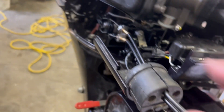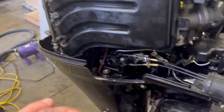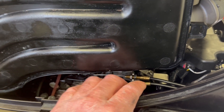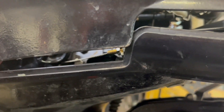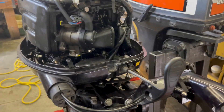The last step is to put the cover back over the grommet and the lower cowl. It's a little tricky, but if you hit the right place it goes in really smooth. When tightening the 10 millimeter bolts, if you sense they're stripping at all, be extra careful. Match up the cover with the rail, push it down, then the bolts screw in — and there we go, the handle's back on, seems to be working right, and we've changed the handle.